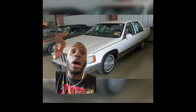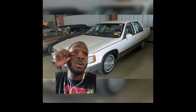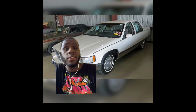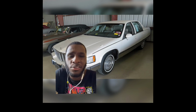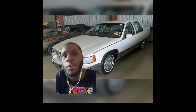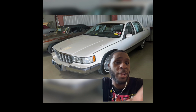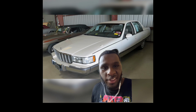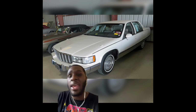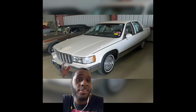It's pretty straightforward. Also, you will definitely need to upgrade the fuel pump in these things because they have been known to go out very quickly, especially since you're going to be LS swapping something this big. I suggest a 240 LPH fuel pump, but if you're going to supercharge a project like this, I highly suggest a 340 LPH fuel pump. But most importantly, please upgrade the brakes in this thing. Do a Corvette C5 big brake upgrade or something like that, or just go with an Impala SS braking kit. This is pretty much just a luxury Impala SS.